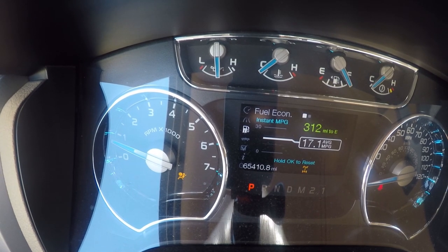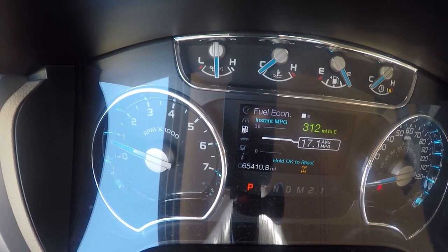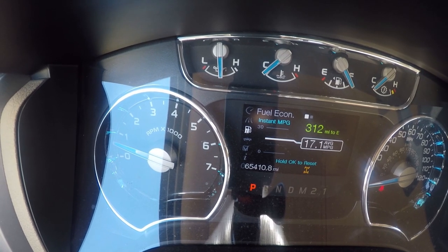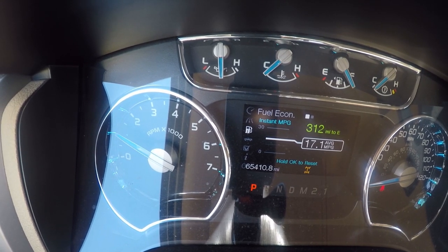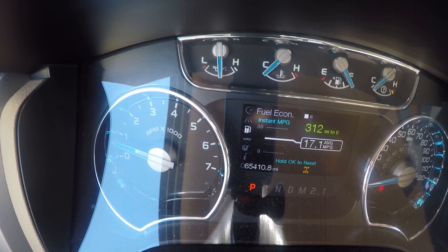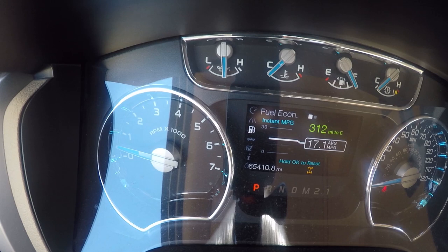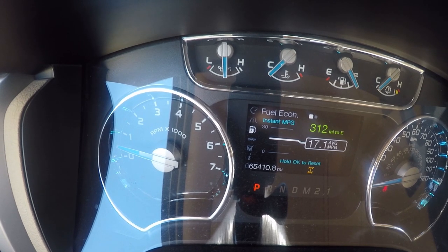And I'd say that there's really not an issue with drain back at this point. Oil pressure came up right away, held steady. Rev the engine, the oil pressure stays steady. That means there's a pressure regulating valve somewhere. Anyway, I don't think there's any issue with drain back. This project's done. Very, very excited about it.